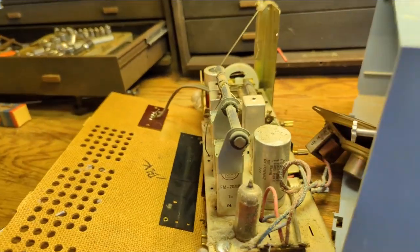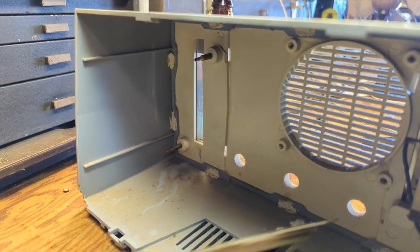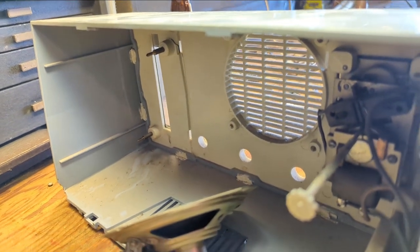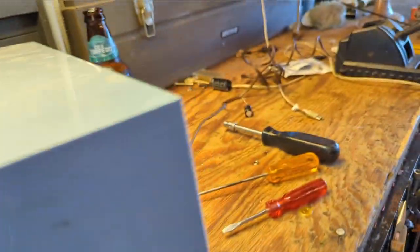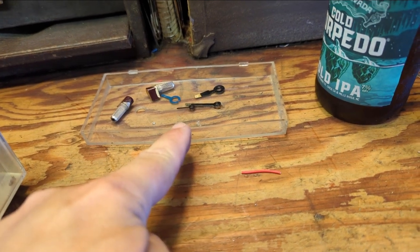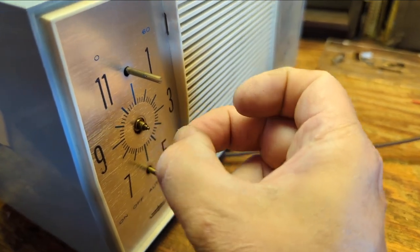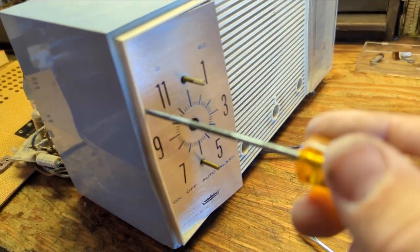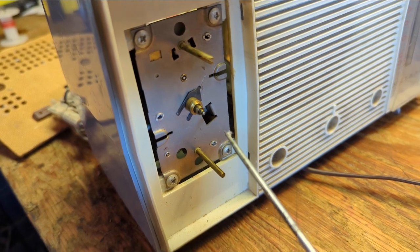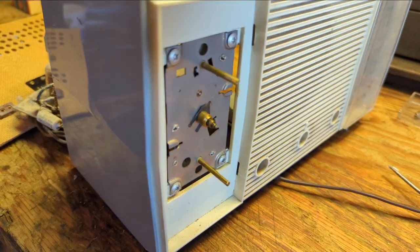Alright, well, I've got it partially disassembled. It really wasn't that bad. There's just two nuts on these little posts that stick up. The knobs are pretty difficult to remove, so I guess that supports the other side and it goes in these slots. I pulled the clock face off — you just use a little screwdriver, press in on these tabs and it just pops out. Then you pull off the hands with your fingernails, just pinch them off. And then there's this metal plate, and underneath we'll just remove these four screws. I'm hoping I can get it out without disconnecting all the wires.